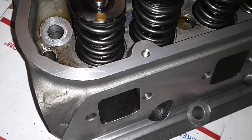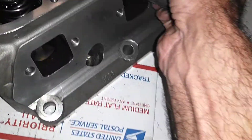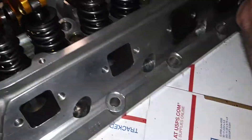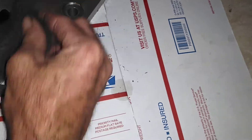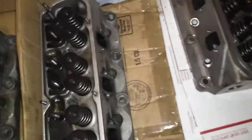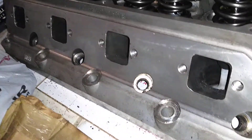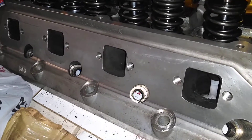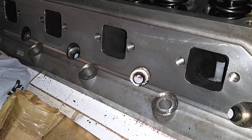I don't believe in using a buffer on heads because you take hundredths of an inch off with that buffer and you don't realize how fast it's going. When I get done with these they will be immaculate. Here on this one you can really see — I spent about five minutes and I can get it perfect. That is baby smooth all the way across, there are no remnants at all. I just add a gasket and silicone on both sides — I like to seal them up one time and be done.